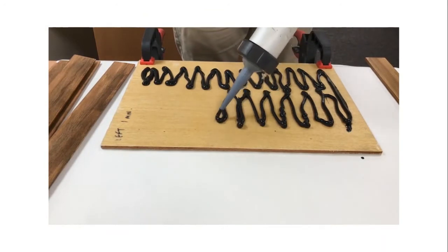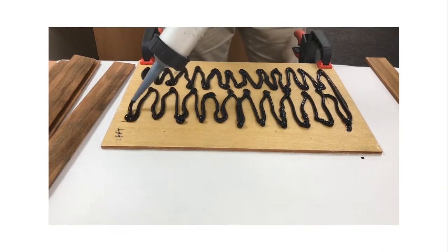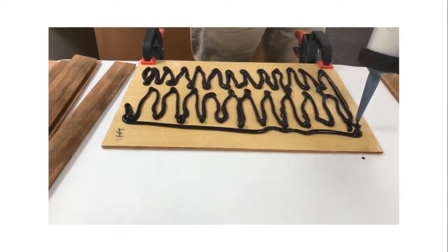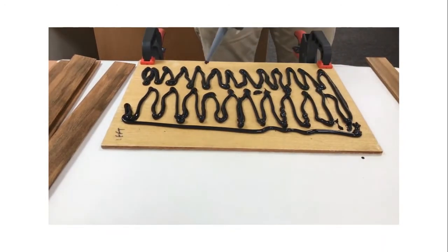Now earlier we talked about bonding, and we put on that fender bonding video earlier, we put two neat lines of adhesive down and talked about the fact that we trap a bit of moisture in there as we bond it and it helps it cure off. But Chris in this instance has just put lots of squiggly bits of glue around the place. So why is that going to go off? Do we have a problem here?